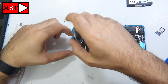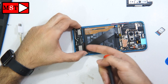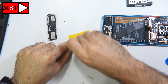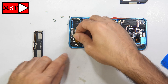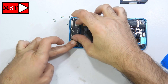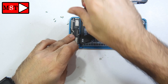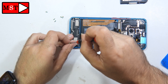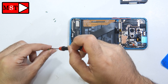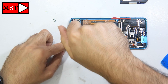The customer told me he saw videos of people putting adhesive, plastic, or a metal piece onto that connector to create a push on it, which keeps the phone charging normally. So I'm not going to replace the sub board — I'm going to do what he asked. I'm using a metal piece the same size as the connector, sticking high-temperature adhesive onto it, then placing the loudspeaker on top and screwing it down. I should have tested with a new sub board but we don't have one in stock.